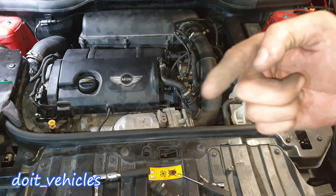If you have a look from this side, you're gonna find the evaporative solenoid, which connects on the intake manifold. The intake manifold has this metal bracket — the solenoid goes like that and you gotta pull it out from there. Then remove this vacuum line from that hole. Also, there's a wiring harness which connects to the intake manifold on the bottom.